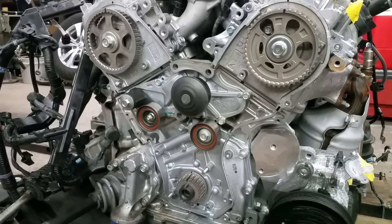You will have to look at three points — three timing marks on this engine — and I'm going to show those to you in a second. I used a Sharpie marker to mark them so they're a little bit better visible. If you take the plugs out, it'll be a lot easier for you to turn the engine afterwards. When you're done, you want to make two full turns. Let's start looking at timing marks on these engines.